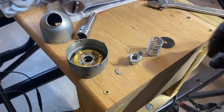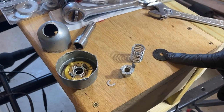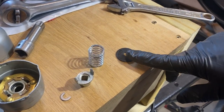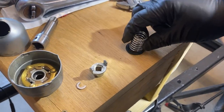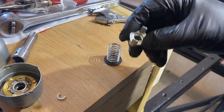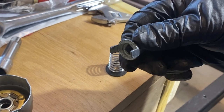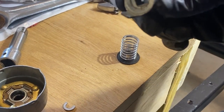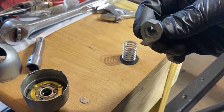We're ready to do our bottom assembly. The first thing is we've got this rubber washer here, which originally was to help with oil. I still want to put it in there even though we've got the newer tube. Then we'll slide the spring on, and then we'll take the spider. The spider has to go up and down in this way, not side to side, because being square you could possibly change that orientation on the horn rod.